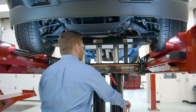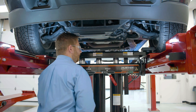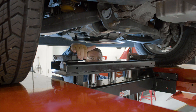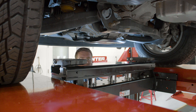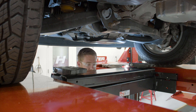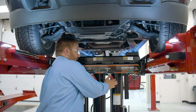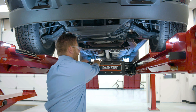We'll bring the vehicle back down to the runways and you'll see the working beam comes back down. Once we're close to the home position, we'll make sure we stow our jack pads on either side. We always want to make sure that the jack pad's pointy end is pointing towards the center of the lift — otherwise, if it's spun to one side or the other, we could run into issues where it's binding up on the side of the runway. We'll bring our working beam back down to its home position, which will reset the locks. Then I can go ahead and pull my pivot lever, pivot my jack back up, and stow it back in the center of the rack.